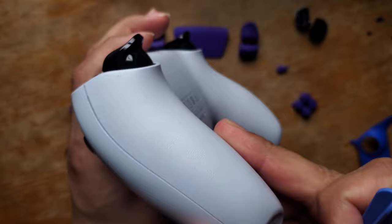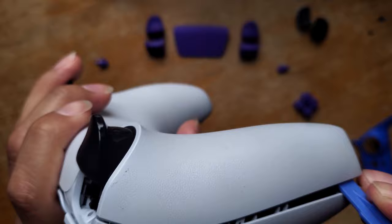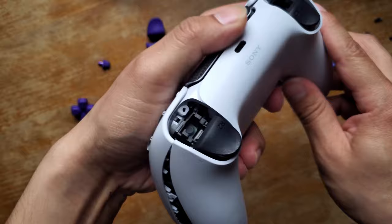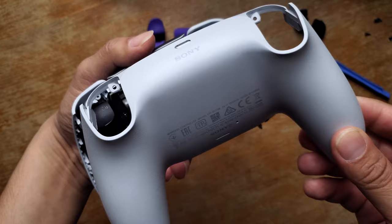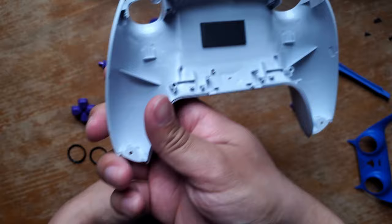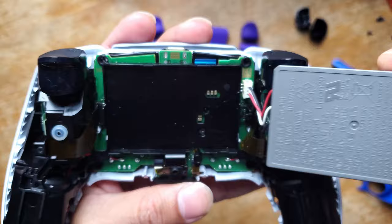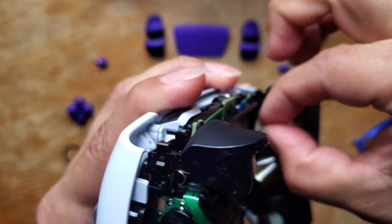Then just turn your controller on either side — dig your tool right in and slide it. That side is going to open up, and then same thing for the other side. From there you can just push up until it comes out — you don't have to push too much. This is the back shell. Next you're going to want to remove your battery — move it aside a little bit, then use your fingers with good grip and slowly wiggle it out.